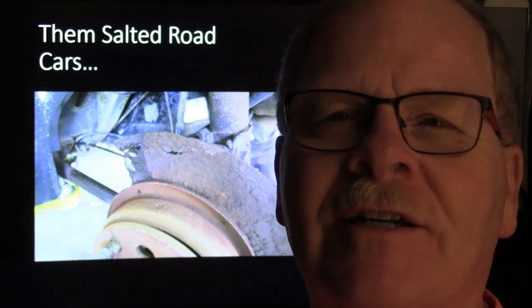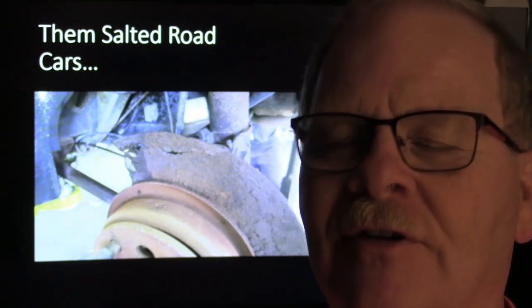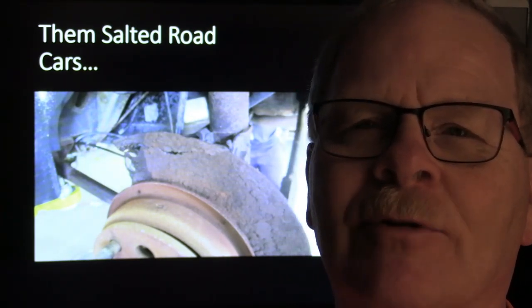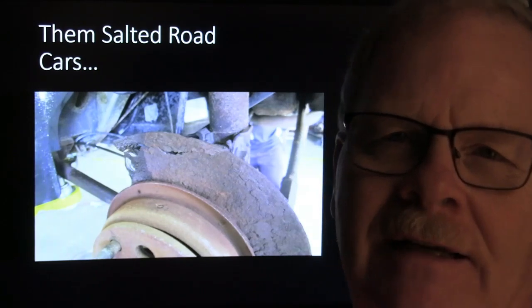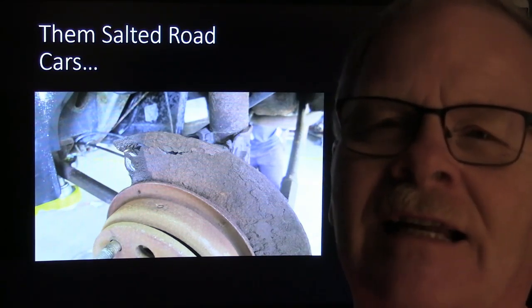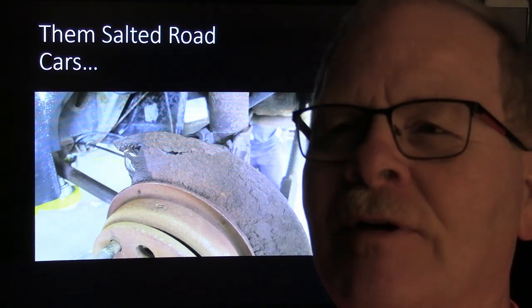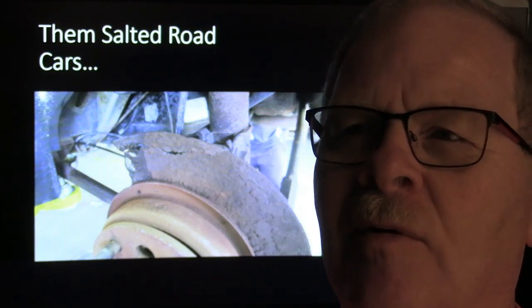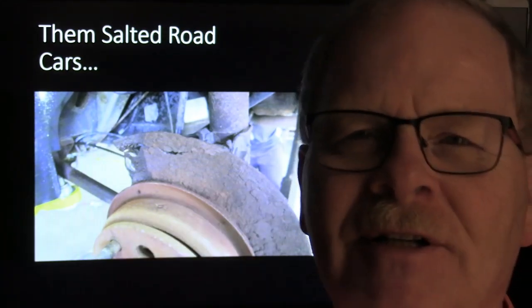My son was working down there with Mike one time, and typically if you've got brake pulsation, when you hit the brake and it's boom, boom, boom, boom, you typically think, well, I've got brake rotor issues, so you machine the rotors or replace them if they're too thin to machine, and then all of that's gone. Well, my son Matt was working down there, and he machined the rotors and did the brakes and drove it, and it still pulsated. And he went in there to tell Mike, he says, "That lady is going to be here in about 45 minutes, and this thing's still pulsating, and when she gets here, she's not going to be happy." And Mike says, "Yeah, here we are with our pants down around our ankles." And so they actually did the rear brakes for free just to get rid of that pulsation, because they had misfired and assumed it was the front one, because usually it is. It's not usually the rear ones that are causing the pulsation, but it can.